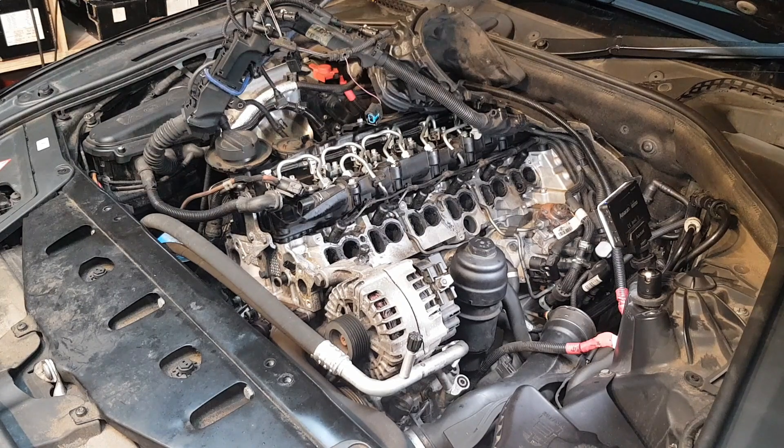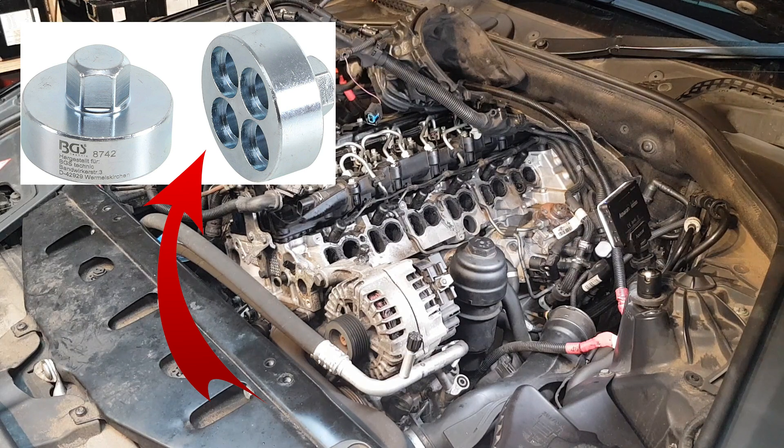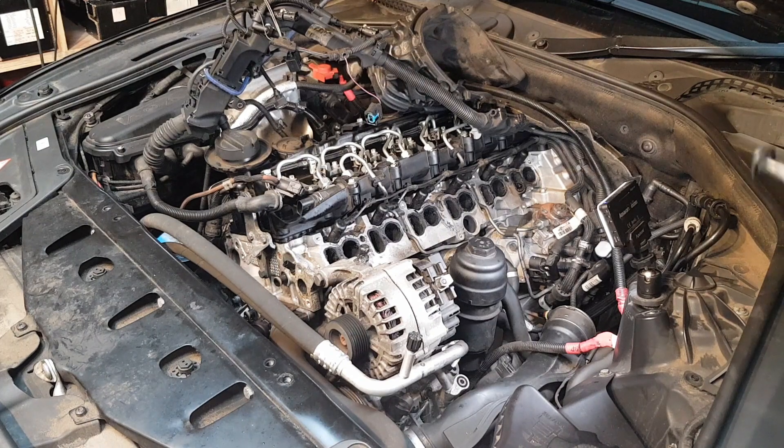So we're gonna attempt now to do a rough clean. We're gonna close the cylinders. Make sure obviously your valves are closed. If you're not sure about this, just do a bit of research. Certain cylinders will have the valves open and some closed. So if you don't have a crank tool, just go and purchase the correct crank tool for your crank pulley. I'm gonna put a picture in the video and leave a link in the description for the tool I'm using in order to turn the crankshaft, so I can close and open certain cylinders that I'm working on.